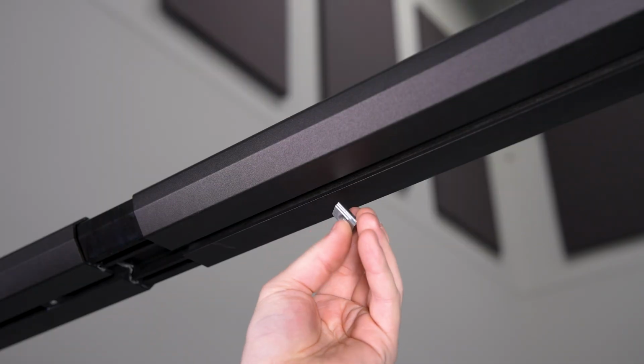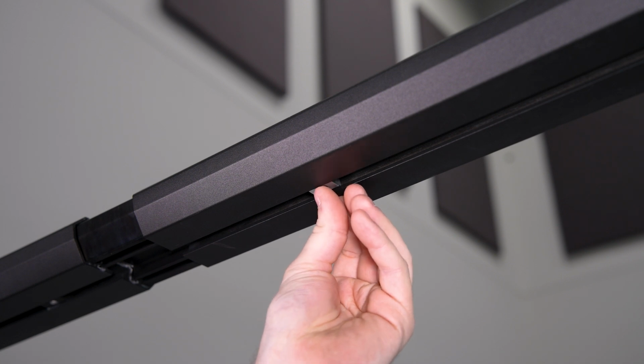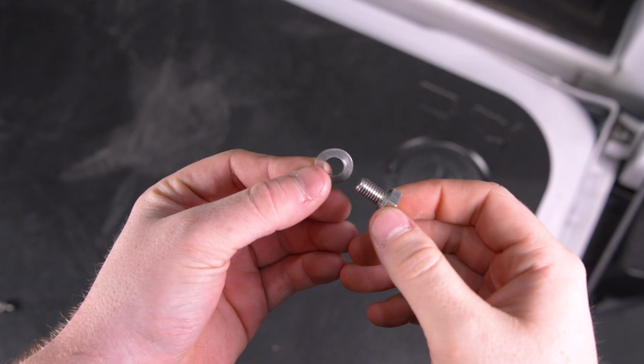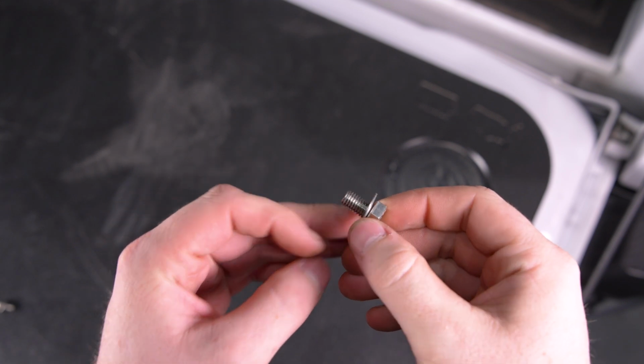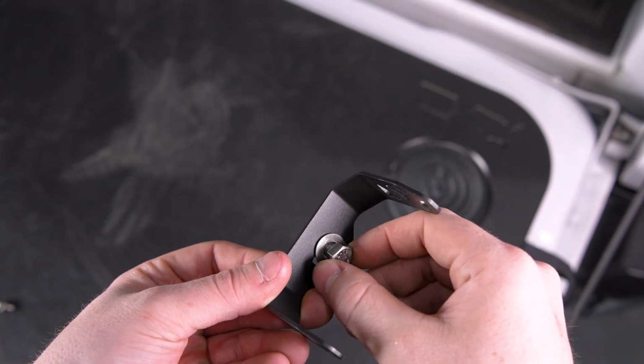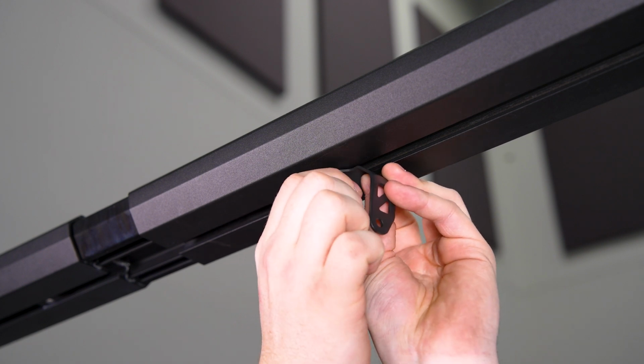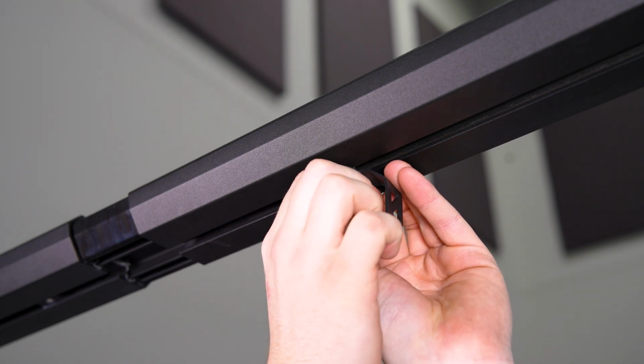Begin by sliding the T-nut into the T-slot on the underside of the IBEX rack, making sure it aligns properly with the slot opening. Next, use a larger bolt and washer to loosely mount the C2 bracket to the rack, making sure the lip on the bracket is facing towards the rear of the vehicle. Keep the bolt hand tight to allow for adjustments later.